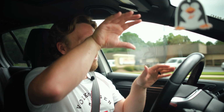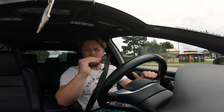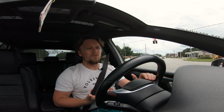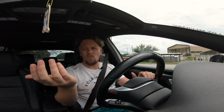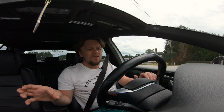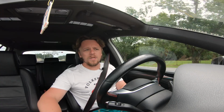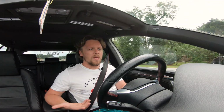It happens. And when you stiffen up the rear sway bar, which is allowing it to kind of go up that way depending on which way you're turning, you actually keep that contact patch on the rear tire on the ground. In keeping it on the ground, you're keeping the front a little bit more on the ground too, helping it dig in better and get better traction on the front inner wheel of the turn. So that's helping you turn in sharper, turn in smoother, and increase your in-corner speeds, your apex speeds.